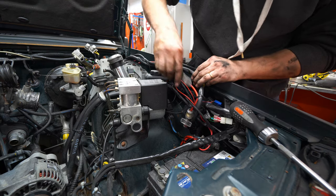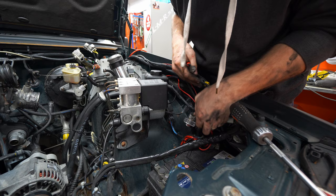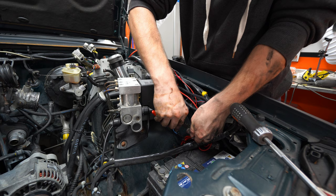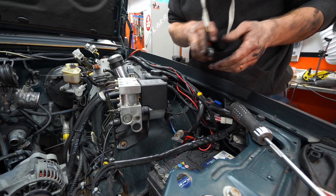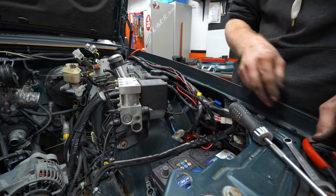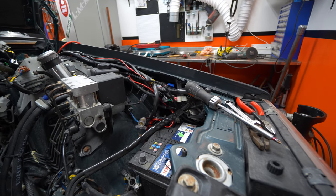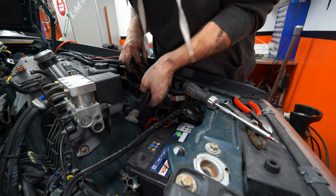When it comes to the engine wiring loom, there are basically two ways to do this. Either you take the wires off the engine itself — disconnecting all the injectors and everything, which is quite messy and hard to remember — or you do it like I'm doing, which is removing the entire engine harness all the way from the battery. It's very easy to just follow the wire, put the whole loom on top of the engine, and pull it out as one unit.